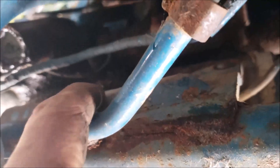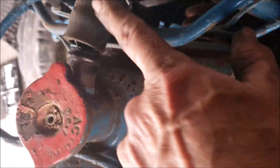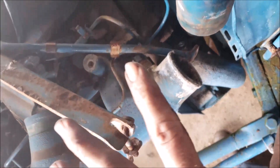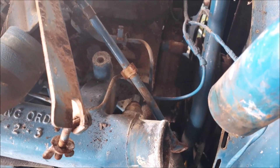Horrible lighting right there. Those two bolts remove the air intake hose - I'll remove these bolts on the side and pushed this back onto the blow-by tube. Now we can wiggle this thing out of here - two things disconnected. We're going to try to leave all this stuff connected, just more work to get it loose, so keep moving.